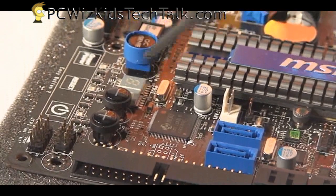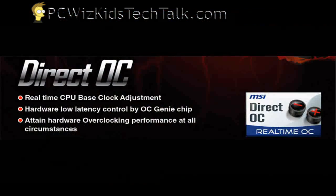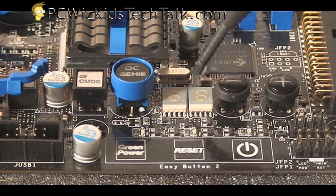It has a nice LED beside it with codes that you can check. And also this plus and minus button — that's actually direct live overclocking. So while you're in Windows, you can press those plus and minus buttons on the board and it will increase the front side bus, that base clock adjustment frequency. So the base clock can be adjusted on the fly. Pretty cool — I like that. I'll show you the results in a moment.